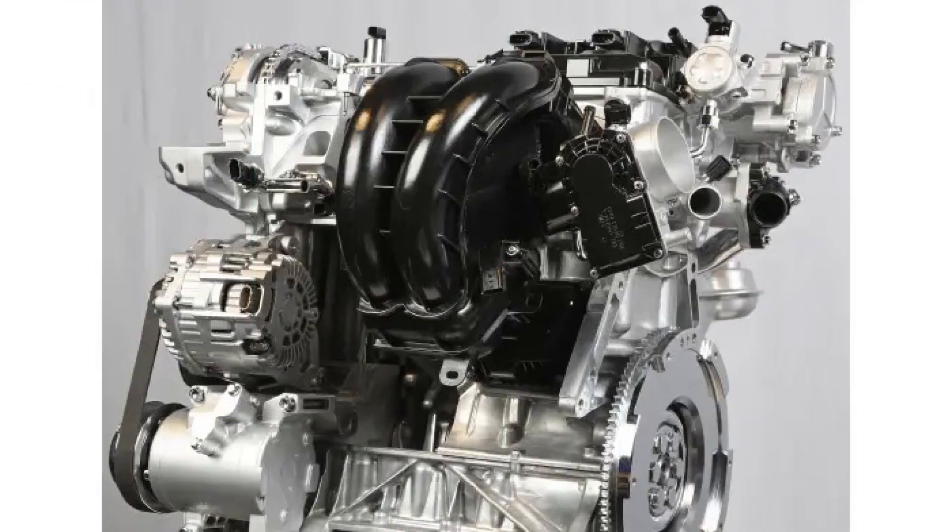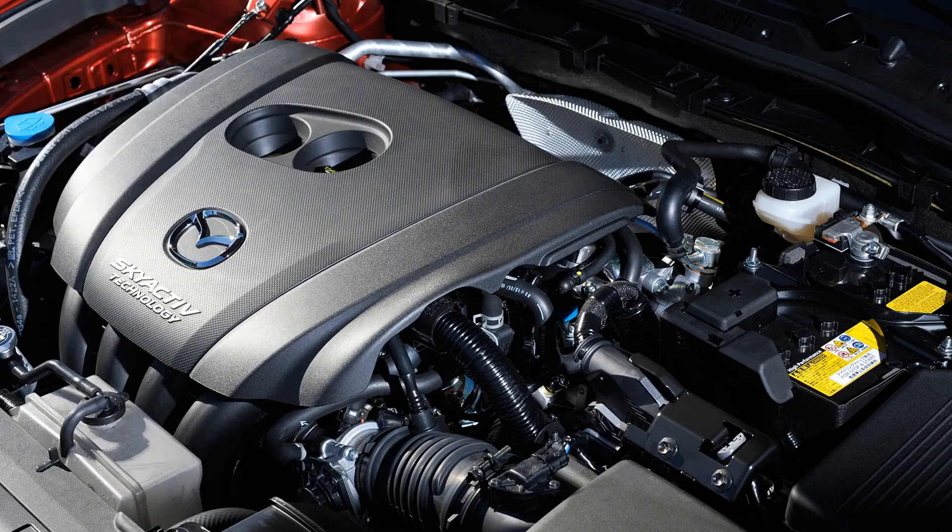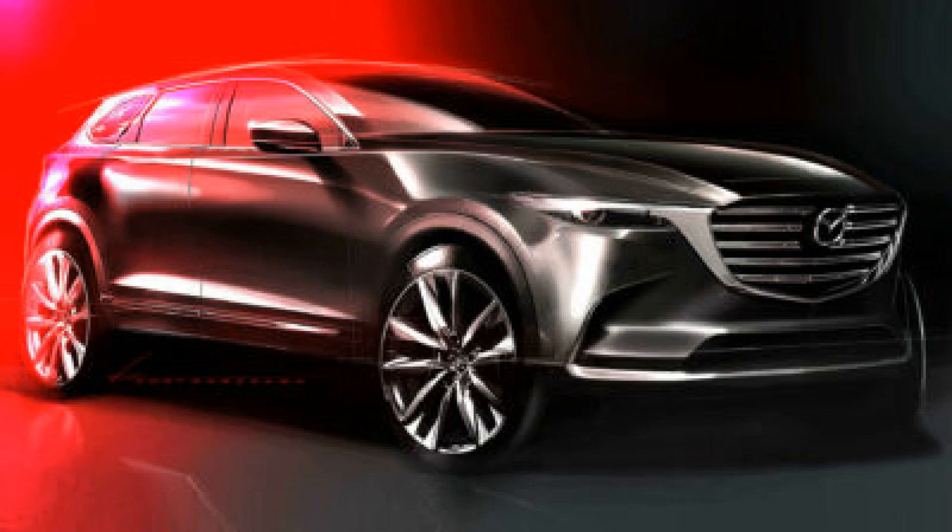Mazda diesel engines: modern diesel cycle engines are characterized by a compression ratio of about 16–18:1. In the Skyactiv-D power units, the designers reduced the ratio to 14:1. Reduced cylinder pressure at the end of the compression stroke allows earlier fuel injection, which promotes better mixing of diesel with air heated by compression. Early injection increases the degree of gas expansion, allowing more efficient conversion of thermal energy into mechanical energy. For improved cold starting, the diesel engines are equipped with improved glow plugs. In warm-up mode, the flexible exhaust valve control system allows a certain amount of exhaust gas to be added during the intake stroke.